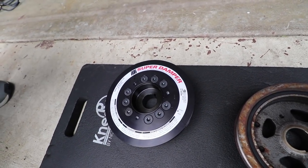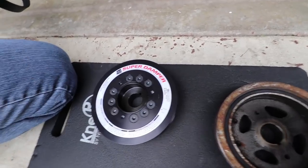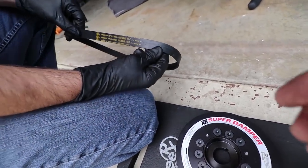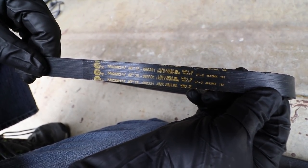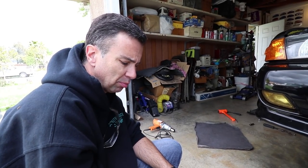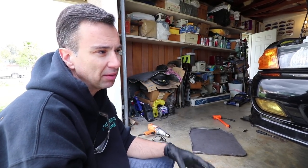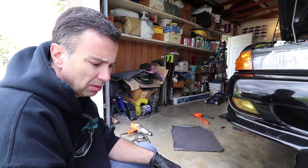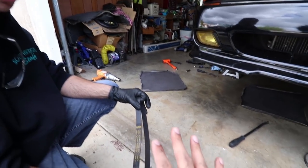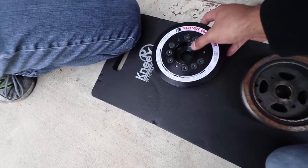Now it's assembled and ready to go. We're going to find out if the belt we have will work and do a road test. One important thing — everything needs to be spec'd correctly. The first belt we're going to try is a NAPA belt, part number 060331, and that's for no air conditioning. They list the non-AC belt as a 327, so this one is actually a little bit longer than that. We have a couple longer ones as backups just in case. It's essential that we torque the crank pulley to spec.